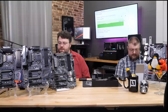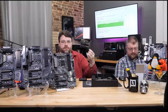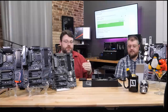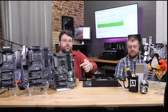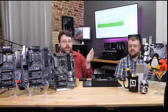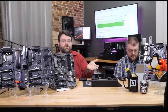Regarding the 5 NVMe, can the board support a PCIe 3.0 x8 GPU connection and 5 NVMe, and how does it have a PLX chip? Yeah, so these two, like this expansion card, go through the CPU. The other three M.2 go through the chipset. So my recommendation, if you want maximum performance, is that you only use a maximum of 3, not 5 NVMe, because these two are directly into the CPU, no bottleneck, and then one of your M.2 through the DMI plus all the other peripherals is probably okay, because you're probably not going to have any other high-speed peripherals through your PCH. So that's 12 gigabytes read and write performance of your M.2 if you want to go that route.